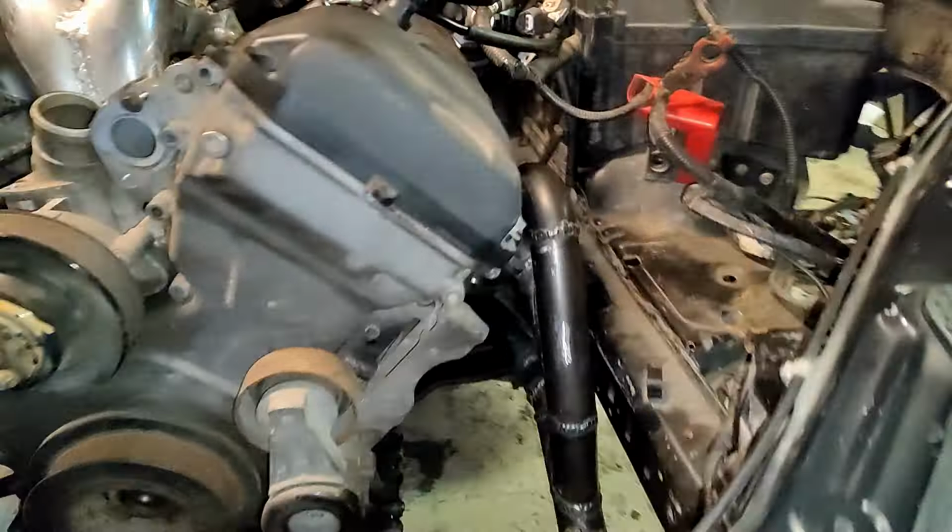I already created some kind of mock-up for a bracket for the throttle body, but everything fits and nothing hits anything, so that's nice. And a couple funny things. So this is the original brake booster line from the Subaru. I haven't modified it, I just turned it a bit, and now it fits into the Jaguar XKR intake elbow. So I can use this because it's after the flap and so on, so we can get the vacuum there.